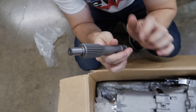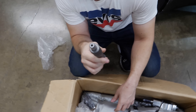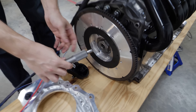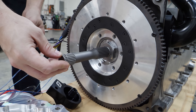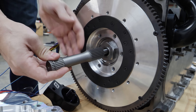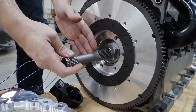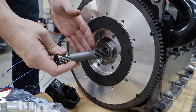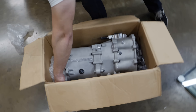There is even more billet goodness on the drivetrain. This is a front input shaft to Mazda converter — I may not have done that correctly though because now we're using Mazda input shafts. With a pilot bearing, it goes something like that, and then you put your clutch in here. This is going to take some retooling. My dream would be to get four plates into this spot — I don't think that's going to happen, but we can always get this machined again to solve our challenge.